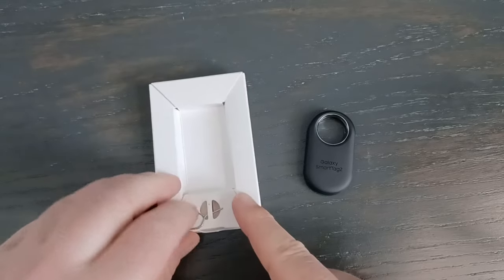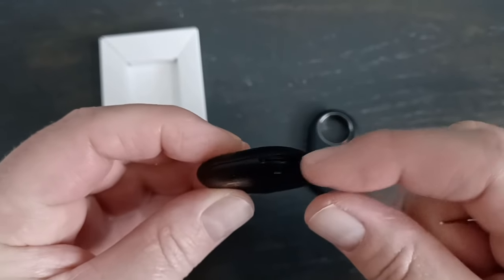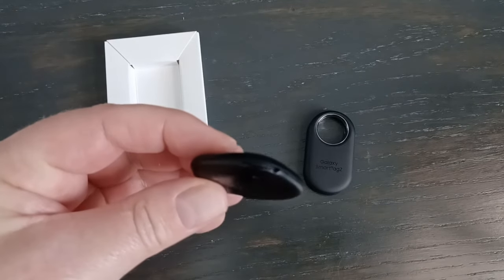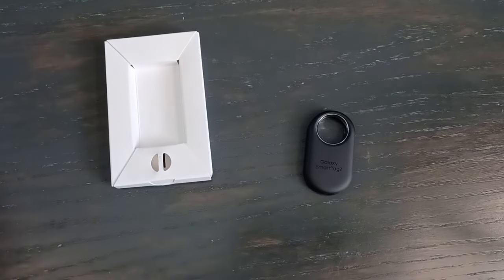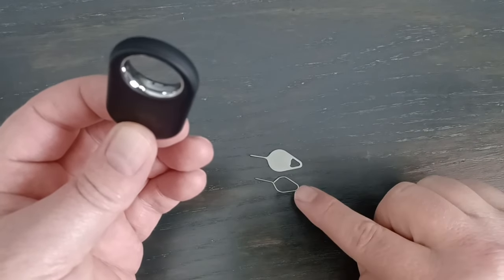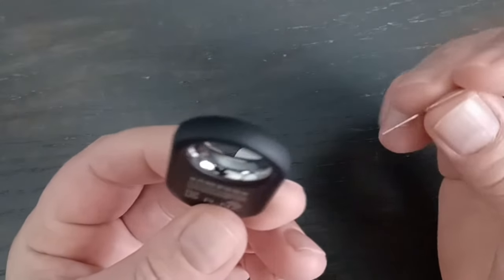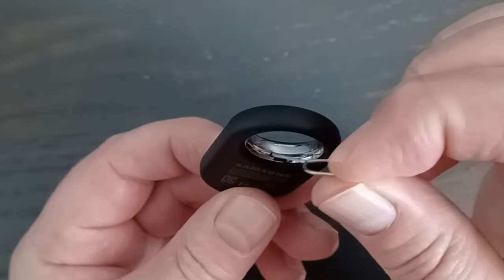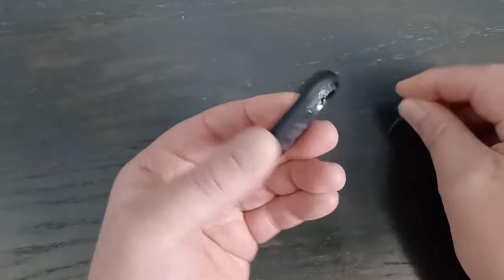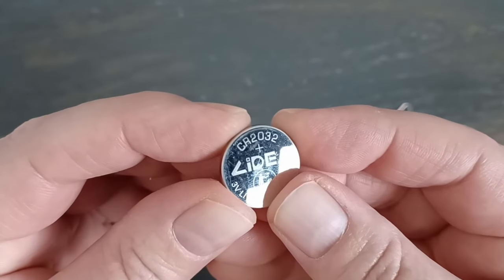In the box you get a little pin, and this is how you change the battery. With the original Smart Tag, you put a coin in and pry it open — it clips together and I'm not sure how many battery changes those clips survive. On the new Smart Tag 2, there's a small hole in the middle ring. You insert the pin — this is the SIM ejector tool that also comes with every phone — push it in, and the battery tray just pops out. It uses a standard CR2032 battery, which costs about a dollar.